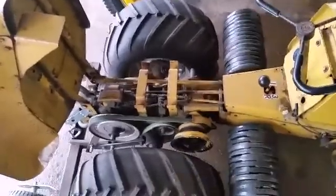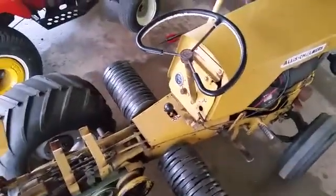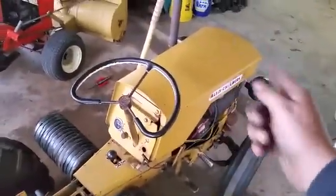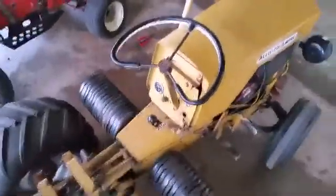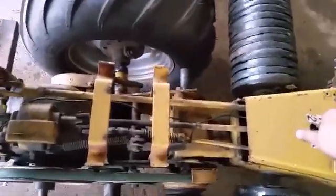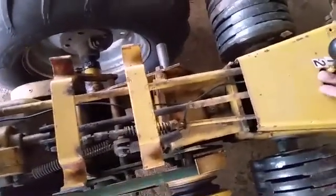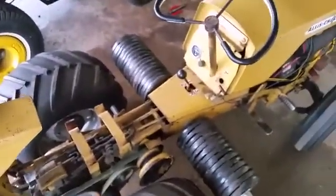Not so early that it's backfiring on the rope, but if I go over and crank it with the starter generator it might pop a little. I'll crank it over with the kill switch, then turn the ignition on after it's cranking. What that does is let the fuel sitting in the cylinder evaporate and become a homogenous mix, so it's more likely to combust when you go to crank it. Oh, come on. Son of a gun — it must have cooled down. I'll just rope-start it — I'll do that off camera.